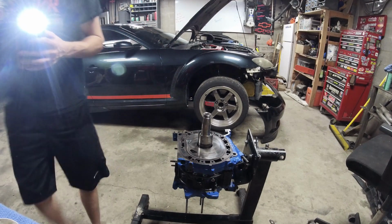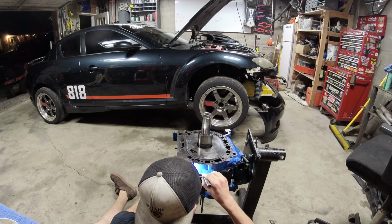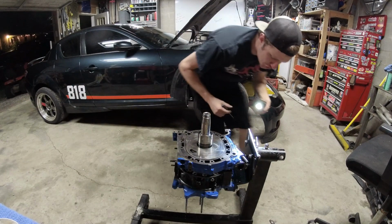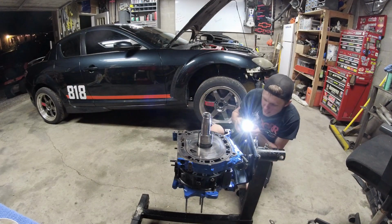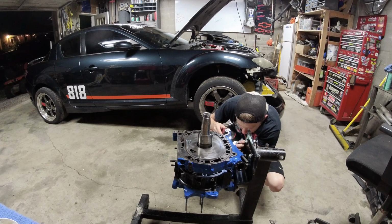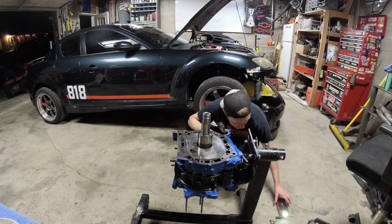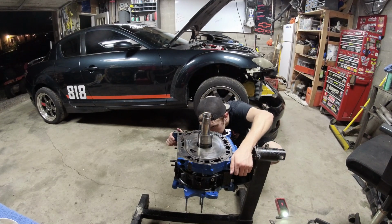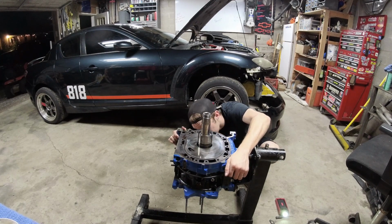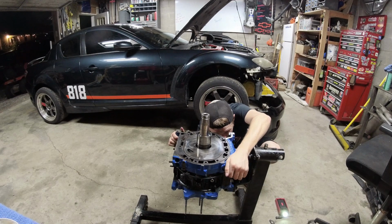Typically what happens right now is those little corner pieces will pop up. And if you glue your apex seals together, you won't have that problem. So you just want to be sure and check this, because this is what happened the first time we put this together. These little corners popped up, which was less than ideal. So now once you've got that done, you're ready to turn this so the dowels line up and set this thing down on your engine nice and slow.